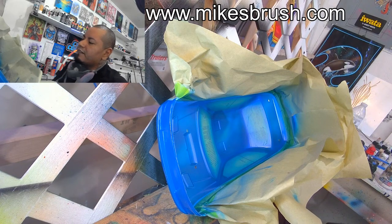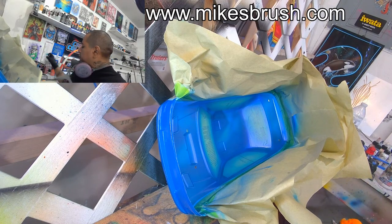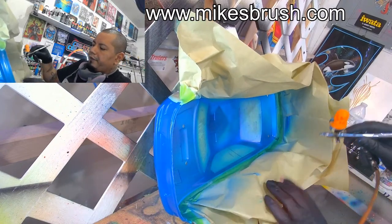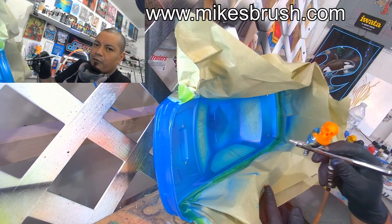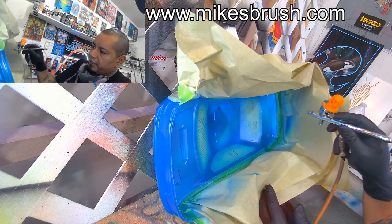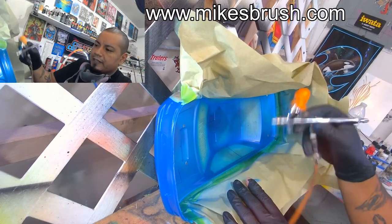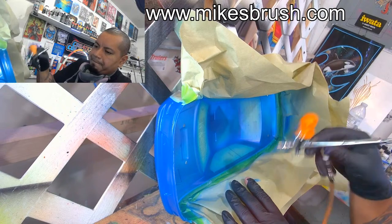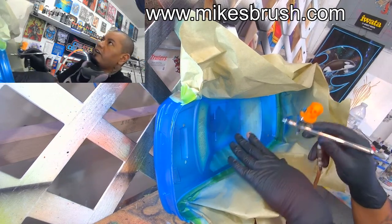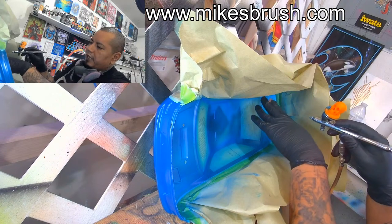It dries pretty fast. Kind of, I guess. There's still a little bit of wetness in there, but that's why you see me give it air in between coats, and all we need is kind of like a surface dry. You don't want to apply heat right away. We'll apply heat once we're done and before I lay my actual protective gloss coat on here. I'll make sure to heat it up good and get the Createx nice and solid before I do that top coat on there. You see, all I'm doing right here is just spraying air, right? Just air, no paint, and I'm just trying to let it dry. Just regular old, good, clean air.